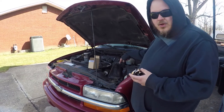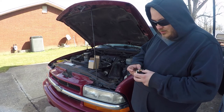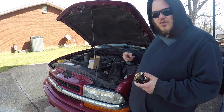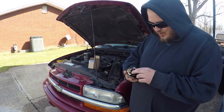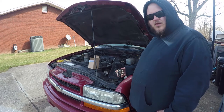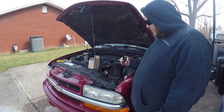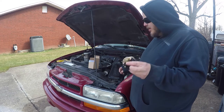The old one is original — it's riveted on there and it's 18 years old. This here is a replacement. What you do is take the steering column out, cut the rivets on the old one, push them through, and then this one comes with two bolts with lock washers, which we'll also put lock-tight on. You bolt this one on and shove it back into place. This is an '04 Blazer, and this works on a lot of the older GM vehicles — the OBS style and newer. So if you've replaced everything else on your steering system and still have a little bit of play, I'd recommend changing this coupler.